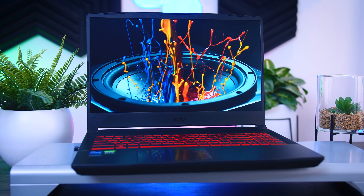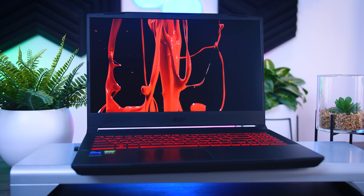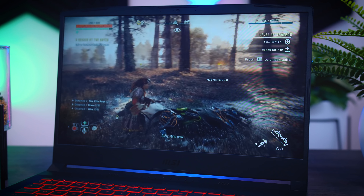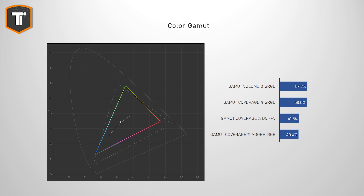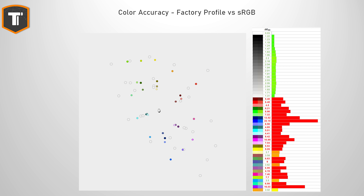When it comes to the display, this 144Hz 1080p screen is pretty entry level — not completely terrible, but it doesn't come close to the 240Hz panels that outperform it in every way. Motion clarity isn't that great, though it would be better than 60Hz laptops for fast-paced games. More expensive laptops will generally get you a smoother gaming experience, but this one is focusing on value. Maximum brightness is pretty low at 247 nits, which will be fine indoors but hard to see in direct sunlight. The color range is also quite limited at around 58% sRGB coverage, so you shouldn't do any color-critical work on this laptop. Contrast isn't that bad and there is enough color to enjoy games and get some work done, but you shouldn't expect more than that.